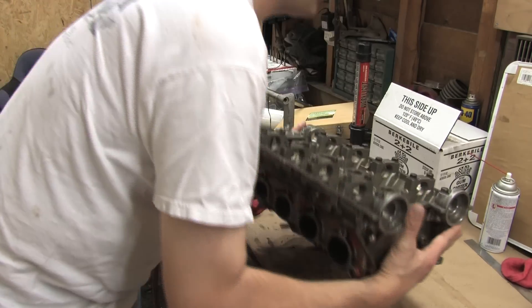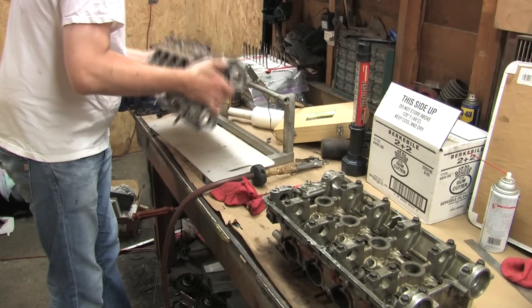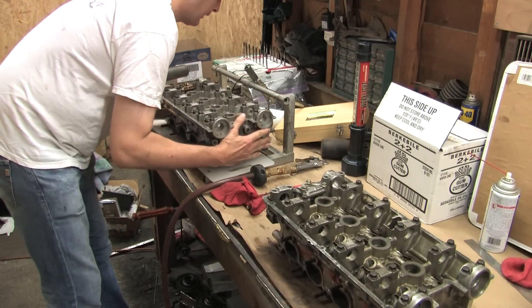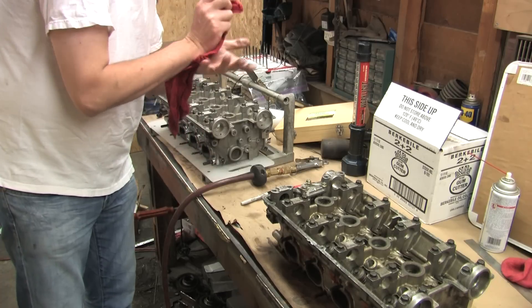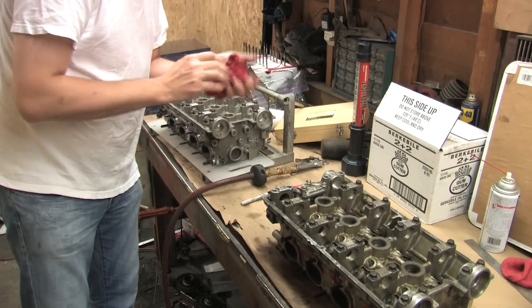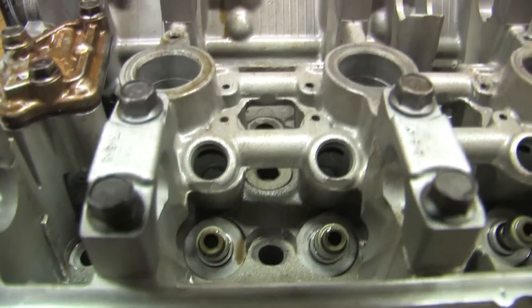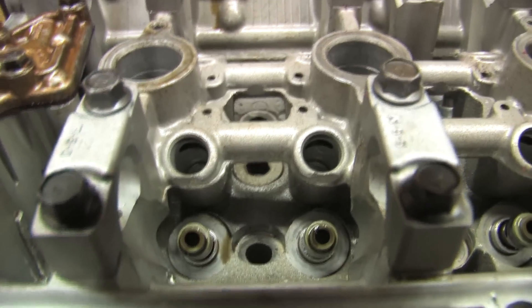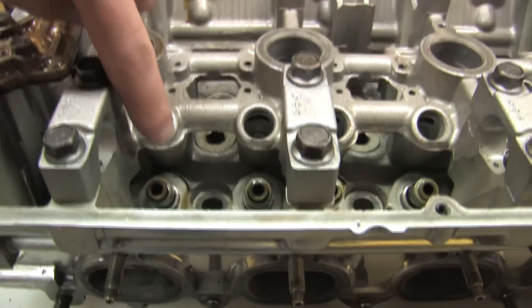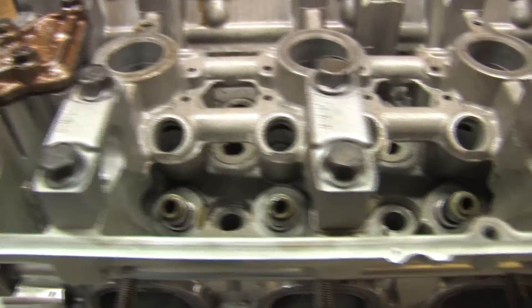It's no surprise that there would be problems with the casting. I went around the block with this one the first time I rebuilt it. I want to show you something close up that you should check your head for to make sure you don't have any problems with casting. Here we are back with Mr. Brilliant again, and we've got casting marks. Look at the places where the mold is sealed up — see around in this area here? Pay close attention to how those look on this head.